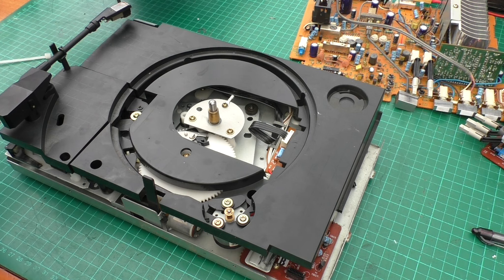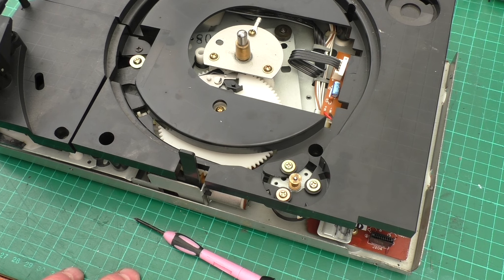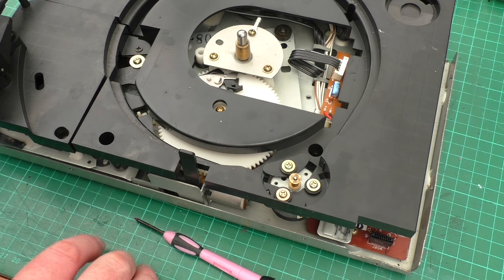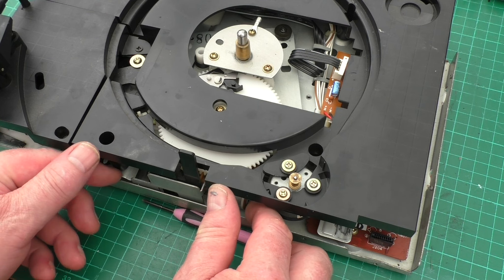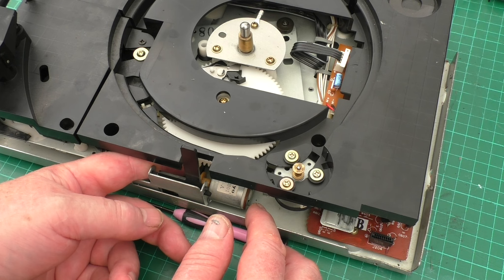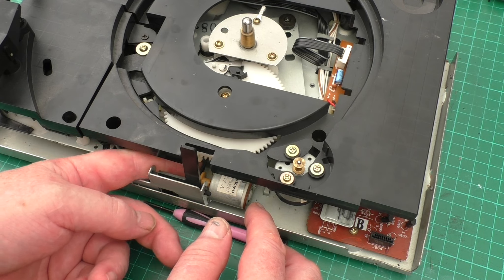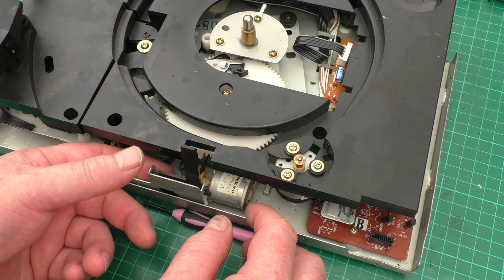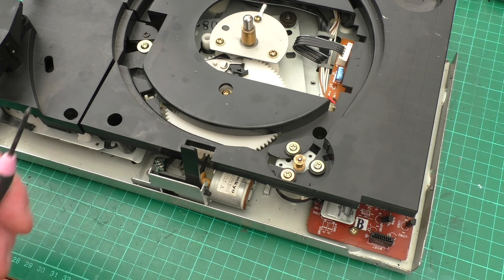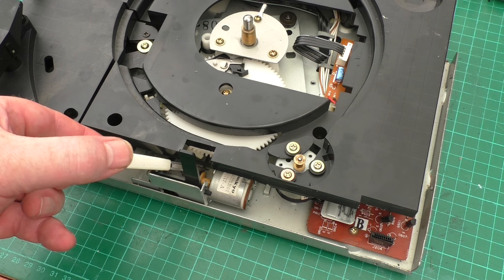Your main problem is going to come if you need to do the slide-in, slide-out tray belt. To change the tray belt - this is the hard bit. Give the tray a very gentle push; as soon as you can get your fingers in by the motor, start turning the motor so you can actually start to see the belt. Don't keep pushing on this because you'll just hear a ratchety noise - all you're doing is grinding the cogs. Then lift off the belt. If there isn't a belt on there, you can just push it forward all the way and lift the belt off.